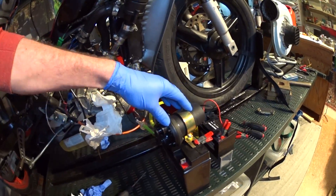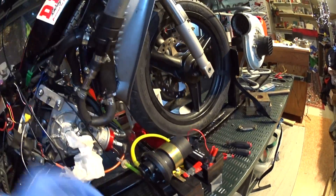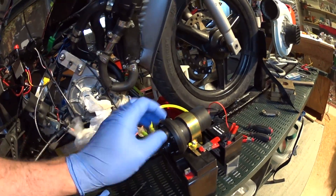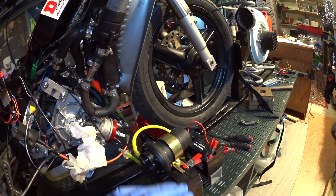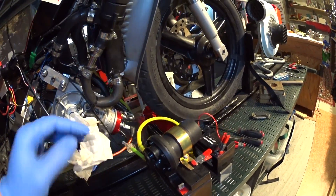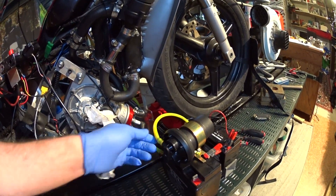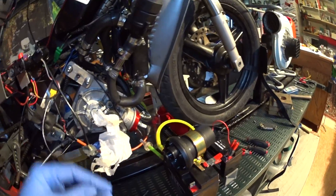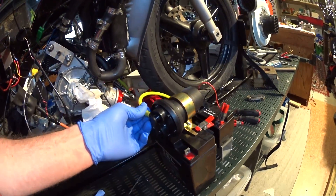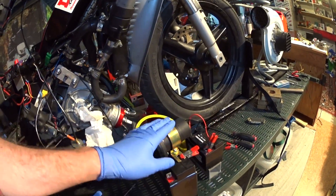I did try to use this pump to see if the higher fuel pressure could give me enough flow for alcohol, but there was too much pressure and the float valve didn't keep shut, so it was overflowing all the time. I could fix this with a bleed or a return line, but I hope I can get sufficient flow without the pump — so to keep it simple, let's see.